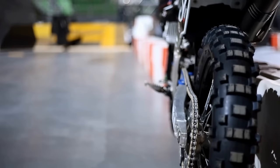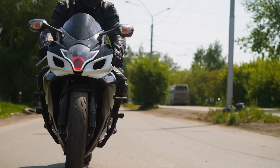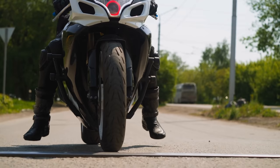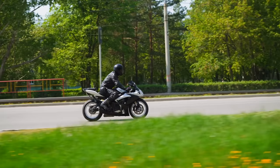Similarly, brand new brake pads need time to bed in to achieve maximum effectiveness — creating a smooth working surface between pad and rotor and allowing the pads to gradually heat cycle. It's pretty simple to bed in the brakes on a new motorcycle: accelerate to about 30 miles an hour and then gradually slow back down without coming to a complete stop. Do that a handful of times while gradually increasing speed before stopping, and your brakes will be bedded in and ready for proper braking.